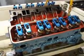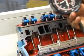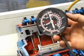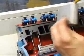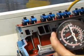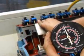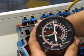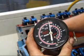I've got a standard vacuum gauge here that you can buy at just about any auto parts store. I have a block with a rubber hose hooked up to it. I'm going to go ahead and place it over this port — and as you can see, we're pulling up about two to three inches of mercury.